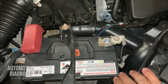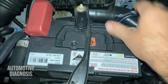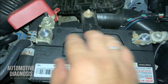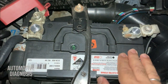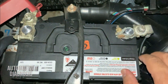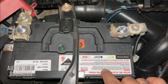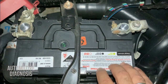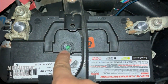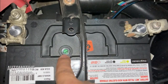The first thing you need to check is your battery. You need to make sure that all the battery cables are tight and secure — positive and negative — and they are not contaminated. If you see contamination, make sure the cables are completely clean. You also need to make sure that the battery is fully charged. A fully charged battery should have 12.6 volts. If you don't have a multimeter, you can use the built-in hydrometer: if it shows green, the battery is fully charged.